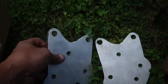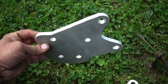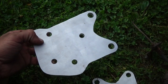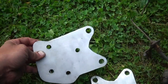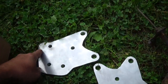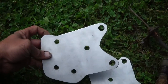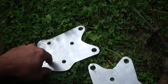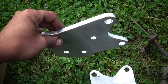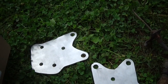The brackets: basically the end of the axle on a Cobalt SS is shaped like this — it's a metal piece welded to the end of the axle. You can't just buy this piece separately to replace the drum brake backplate. So I pulled everything off, took a piece of paper and pressed this shape out, marking where the bolts went. Then I ordered some aluminum plate, cut it out on a bandsaw, and drilled out the bolt holes. I made two — one is the driver's side, the other is a mirror image for the passenger side.